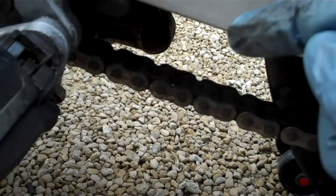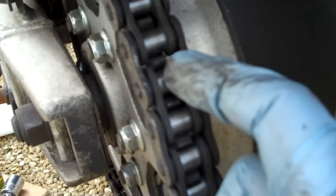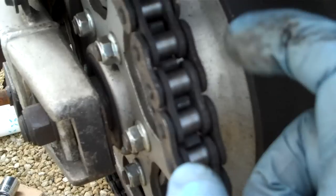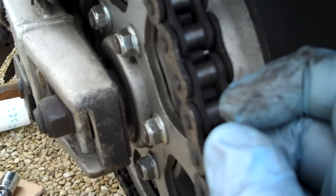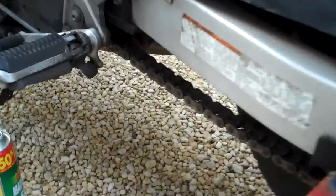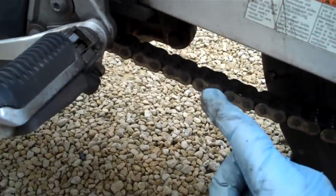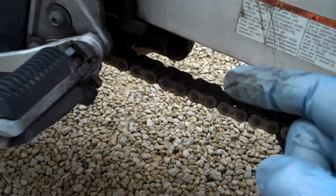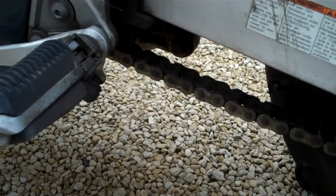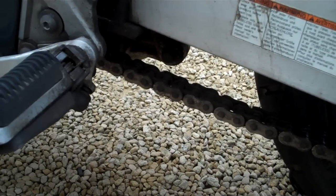It also holds the salt. That chain there is a bit dry — I should lubricate it more often. I've had Harleys for so long I've kind of got out of the habit of chains, but I'm getting back into it with a Bandit. The important thing is to clean the chain first before putting more lubricant on top of the dirt. Chain life on a well-maintained bike with an automatic chain oiler should be 35,000 to 40,000 miles. Ordinarily I'd say about 20,000 to 25,000 miles. If you don't maintain it, you can get that down to five or six thousand miles — the life of a tire.